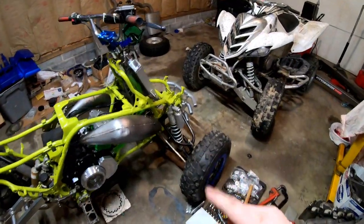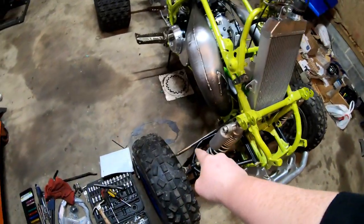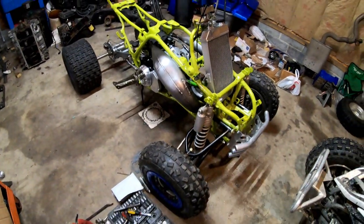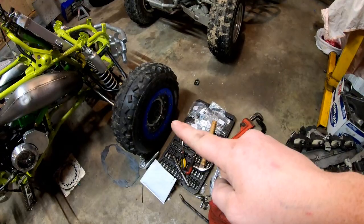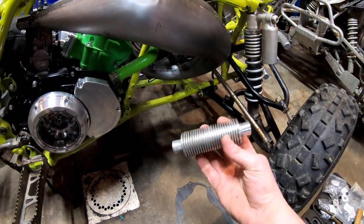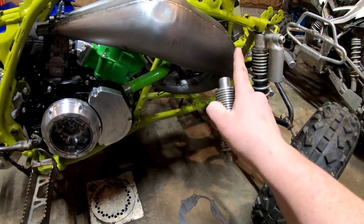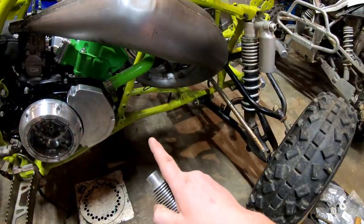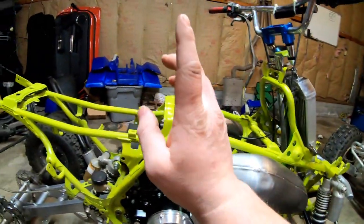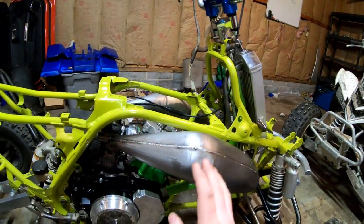We'll start with the front end, work our way back. Front wheels definitely need an alignment. I definitely want to scuff those rust spots off of the tie rod ends, get that all aligned, ready to go. We got to put all of our lug nuts on the wheels. That goes all four around the quad. We've got to install our heat sink into one of the radiator lines. I'm thinking on the way down to the water pump. We've got to put fluids in this thing, get our twin petcock installed on the gas tank over there, get that on. I have premix, gasoline.